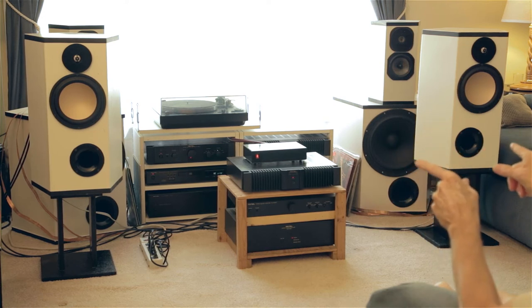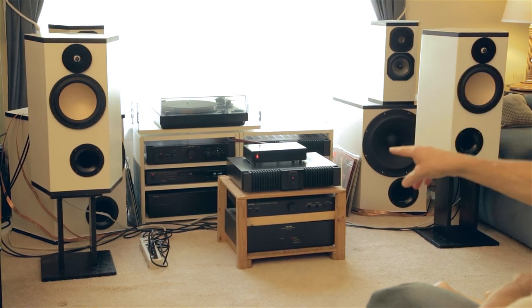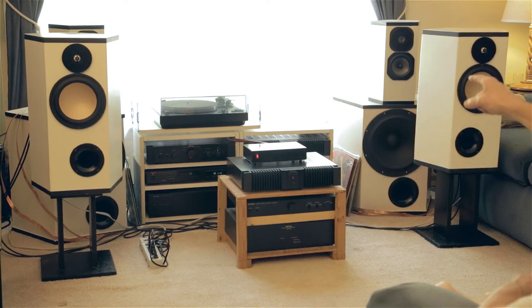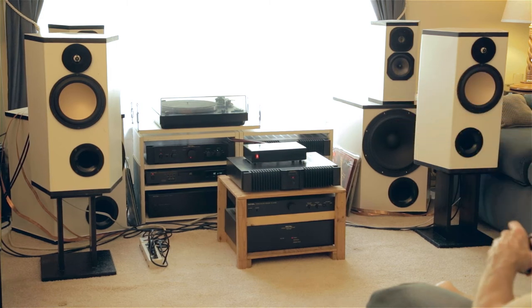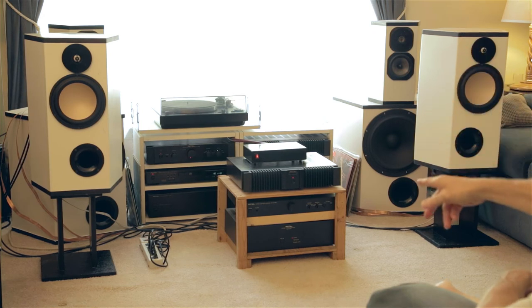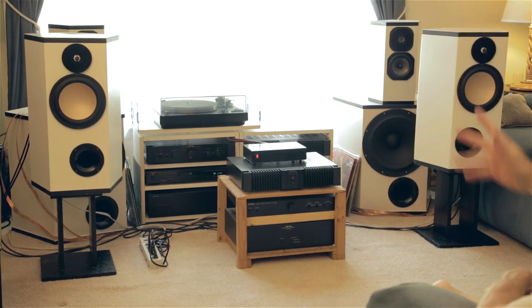Putting it in here gave me the ability to compare to the top-of-the-mountain, which is what the whole point was — to try to emulate that super clean system in a less complex design. The other reason was that I had my CD player and turntable on the back wall, all hooked up through that control amplifier and ready to go. All I did was pull the input lines out of the control amplifier that normally feed the electronic crossover in the back system and plugged them into my electronic crossover out front. The signal is now going through that control amplifier. My control amplifiers don't color the sound too much, so it wouldn't matter much which one I use.